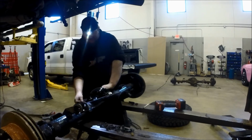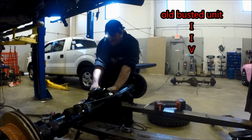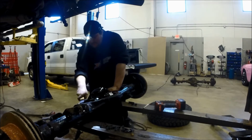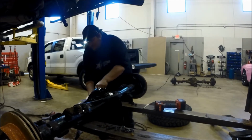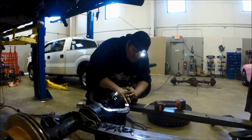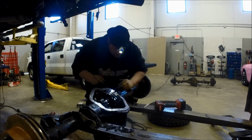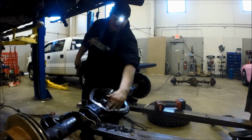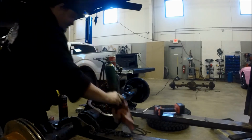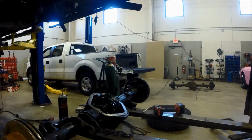It'll reveal machining marks that you didn't even know were there anymore. And that's how fine it gets against the sealing surface without actually carving into it. If you're doing aluminum or something like that, you can bite in there a little bit, but as long as you're careful, this thing will precisely push and make very quick work of this. So it only took me a couple minutes to do, and you feel a lot better about the gasket surface when that thing is all clean. So the next step is we are going to clean the gasket surface up with a little brake cleaner.